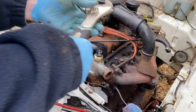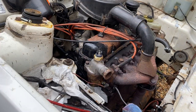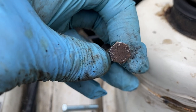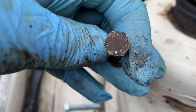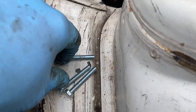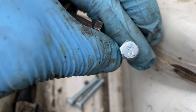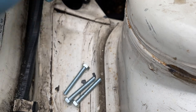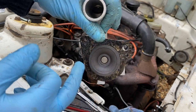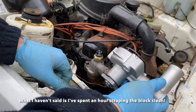Crush the washer — that's as tight as I can get it. Next is the water pump. I've just been to Toolstation to buy some new bolts. The old ones are marked 4.8 which isn't high tensile enough as they need to be torqued to a specific setting, so I've got new 8.8 high tensile bolts from Toolstation. I've prepared the water pump with a smear of gasket sealant on both sides of the gasket, and now it's time to offer it up to the engine.